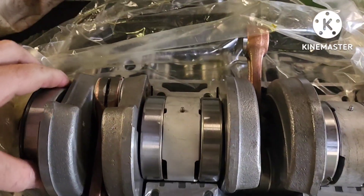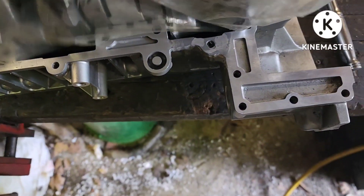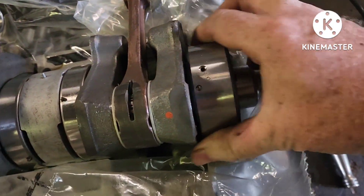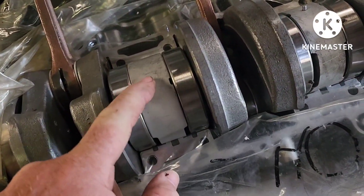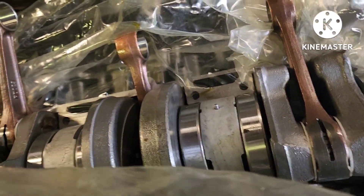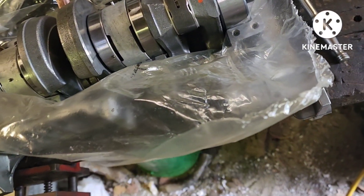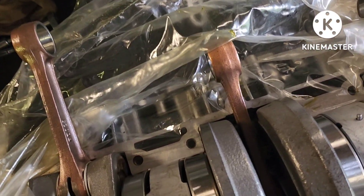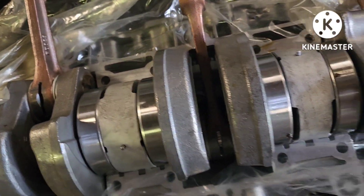Here's my new crank out of the bag, ready to go. You'll notice the lineup pins — those are going to go over to the side. Here's where that pin is going to go into this bearing. This bearing is not a press fit on the front — you can actually slide that bearing completely off, so it's not a press-to-fit bearing. On these bearings here, there are indentations in the case where those are going to sit so they stay in place. You've got to line up your pinholes if you have them — I showed it in the previous part of this video. Line that up, and then you'll kick these over to the side in the little indentations made for them.